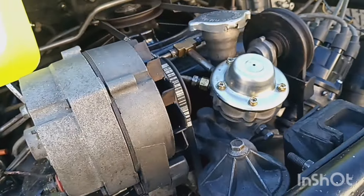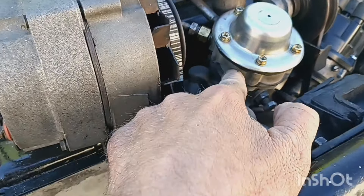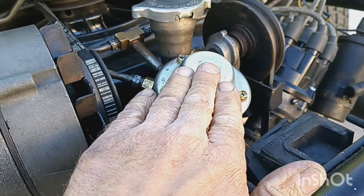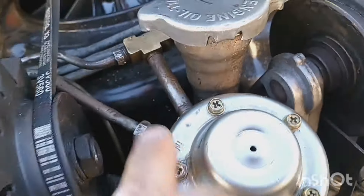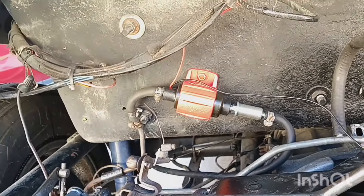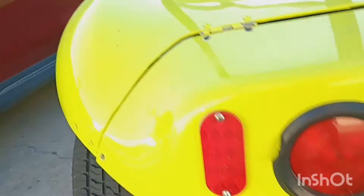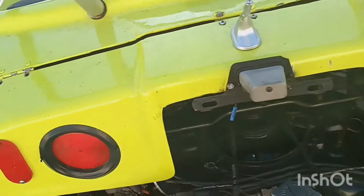So I got the fuel pump system — I say 'system' because this is a blank right here, just a pass-through, so you still have the look of a mechanical fuel pump but it's actually just a dummy pump. It doesn't pump anything. What pumps is the Edelbrock fuel pump mounted right there, and you'll hear it when you turn the key to the 'on' position — it'll fill the carburetors up if it's been sitting a long time, as opposed to a mechanical pump that doesn't do that.